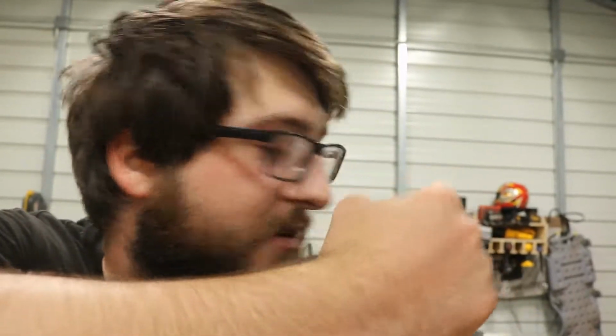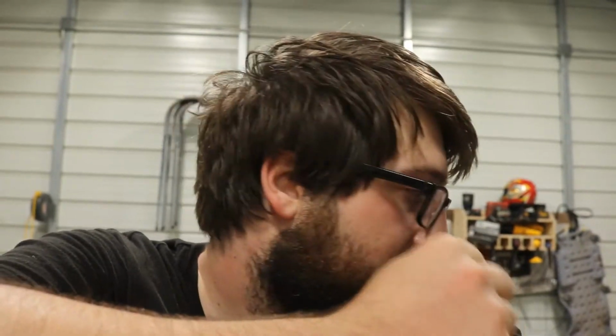Leave the intake. The intake we're buying is a Fast 102 LSXR that has been ported. So we'll leave that intake because that intake's really good. And we're just gonna keep it naturally aspirated. I know it sounds crazy, but a naturally aspirated LS3, we're gonna make around 14:1 compression, which is insane. Factory is 10:1, I believe. And a lot of people when they do stroker kits usually get 12:1 compression out of it, but we're gonna be getting 14:1 compression out of this bad boy motor.